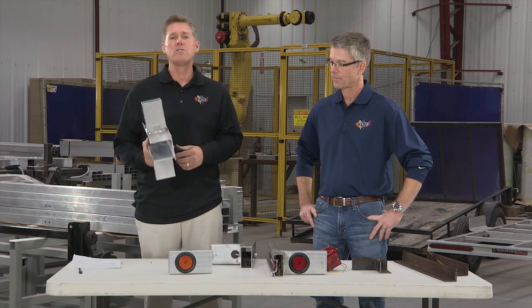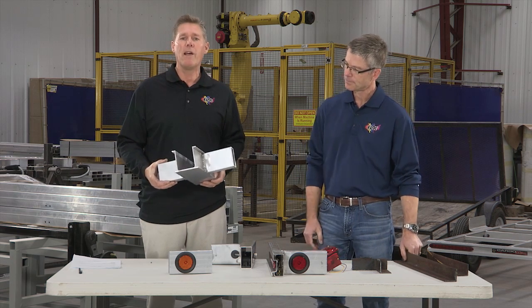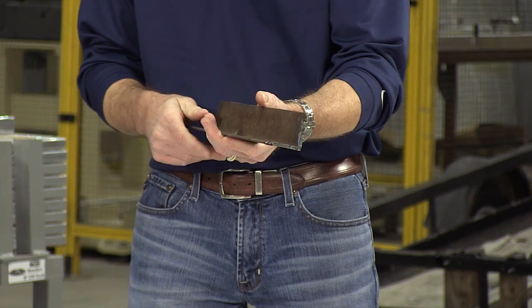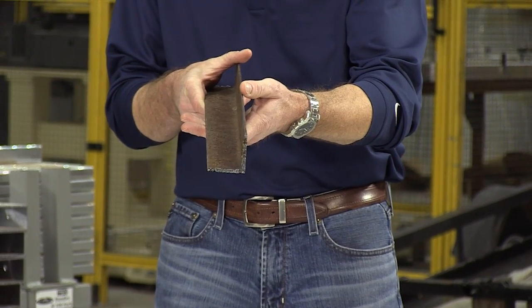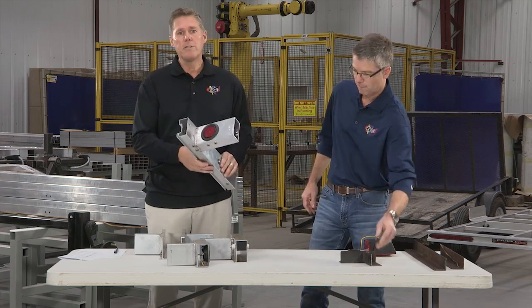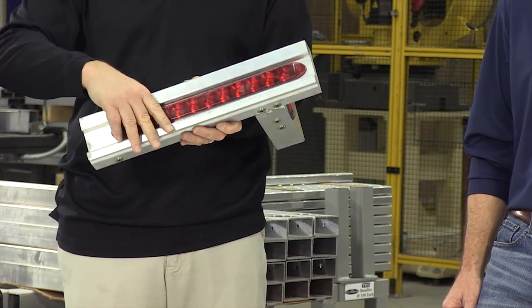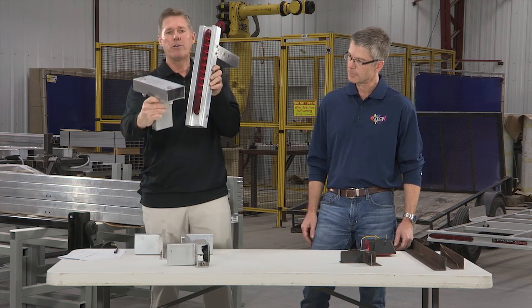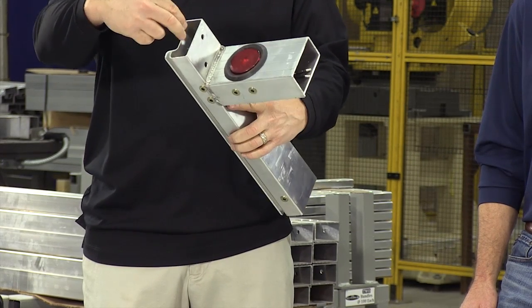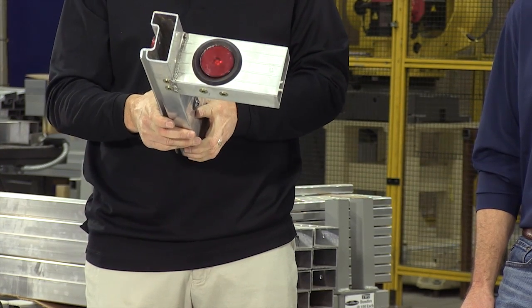At the heart of the Cargo Max is our exclusive aluminum superstructure. It's designed with many different custom extrusions which make it lightweight yet super strong. A big difference between that design and a common utility trailer — most utility trailers are made out of one component like a piece of angle iron, usually steel, so it's rusty and just doesn't look good or last very long. Again, with custom extrusions, we can extrude a certain shape and build in a feature. In this case, we've built in a feature that protects the light — if you were to back into a tree, you won't have any damage. Additionally, we have the wiring system encased inside this hollow tube, so it's never exposed to the elements and won't get snagged when driving over obstacles.